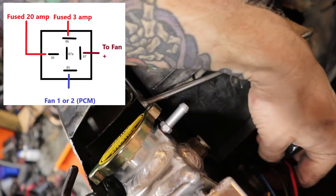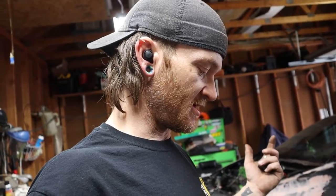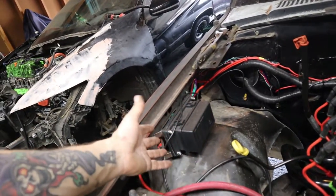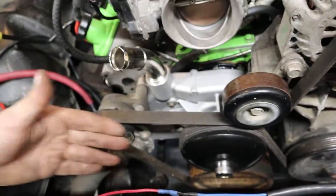I have it hooked up positive and negative to the fans, but once you have the relays in place you'll want to check which direction the fans are blowing. I ended up having to swap the other fans around and run positive on the negative and negative on the positive — they're fully capable of doing that, so don't worry about it. Make sure you use a big enough wire and make sure all wiring is out of the way and not going to fall into the belt.